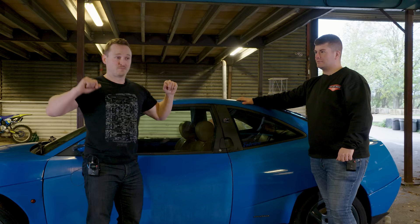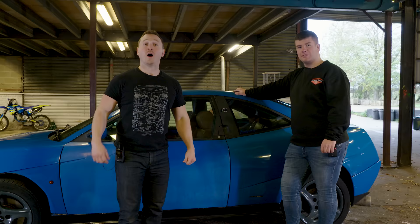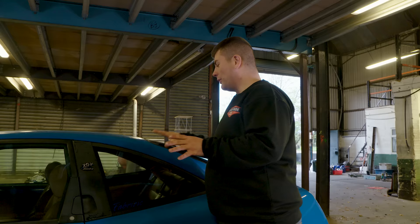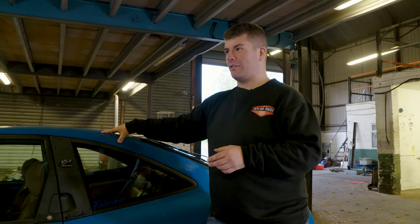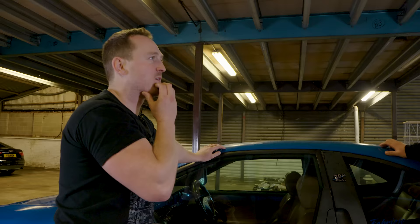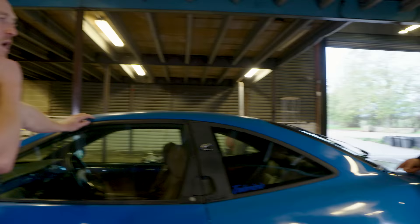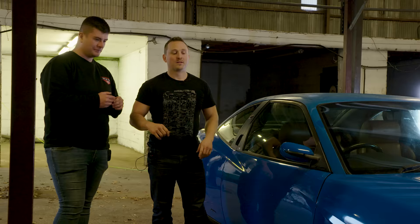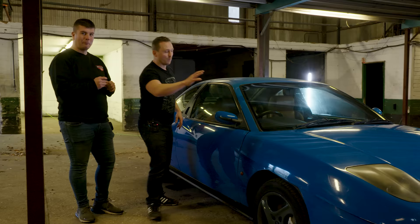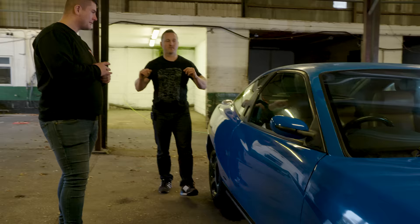You're failing to mention the one big thing — we're painting the whole car with rattle cans. With the lacquer peel, I like to learn about bodywork. I've always wanted to do it. I know from experience that when you buy cars with lacquer peel you have to sand it back really far, because otherwise the new paint will react with it. So we might have to take the roof, the boot and this quarter panel down to bare metal. The most professional thing for us to do would just be to wing it. We need to take stuff like indicators off — these are actually the same as Ferrari indicators. Wing mirrors need to come off, all the badges need to come off, and then we're going to attack the entire car with a sander after covering everything up.